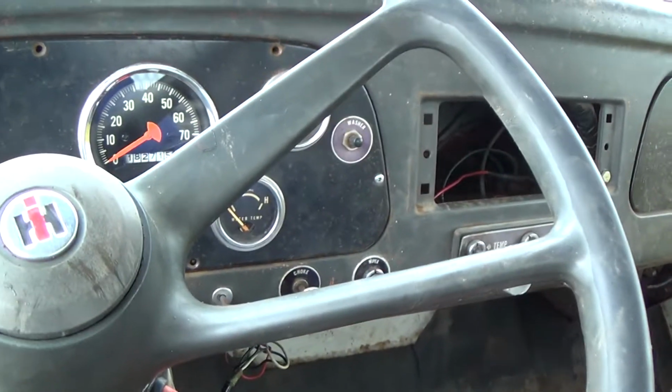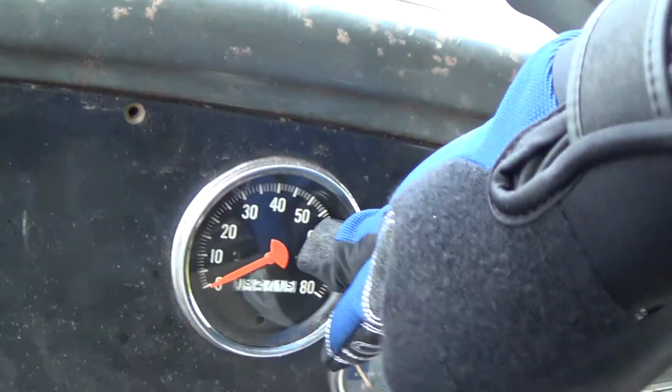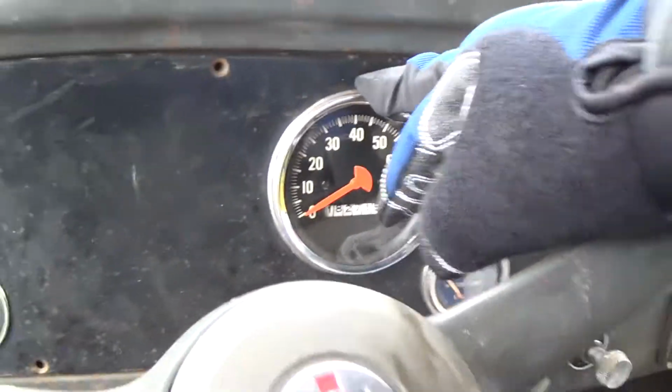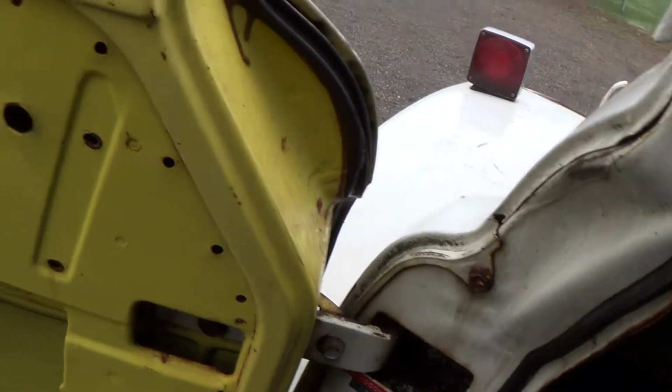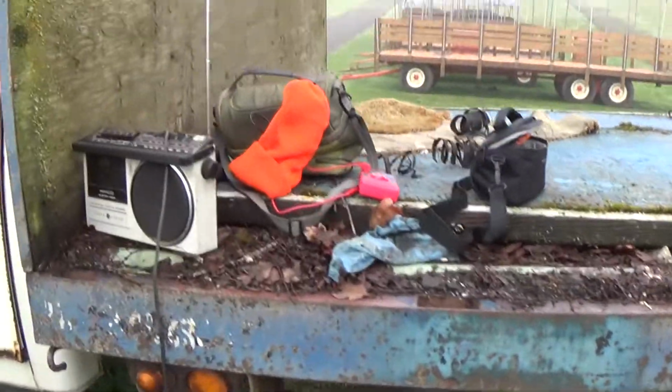And again, it's not going to work, but there's a gearbox in the speedometer here, because with the 2-speed rear end, you have to have a gearbox in the speedometer drive, so I hooked that up and it works good. Let's see, what else did I do? I guess I took off both side racks because one of them was okay and the other one kind of wasn't.